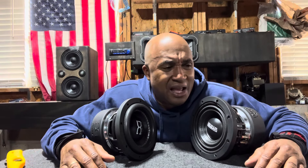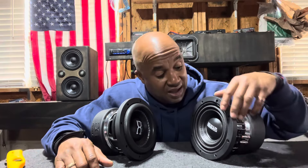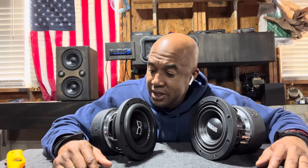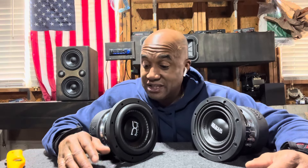But looking at the overall, the DC Audio is going to play louder overall where the U was just excelling in the lows. And I think that pretty much keeps up with the Sundown experience — people love the lows, but not all that balance, maybe because they put more emphasis on X-Max and cone area. Whereas DC Audio — you saw the movement — it has more throw, but it has to have more throw because it doesn't have the same cone area. As I showed you on the video with J-Audio, that's just fact: if you have more X-Max but not enough cone area, you're going to try to make it up in displacement. Whereas if you do have the cone area, you don't need as much X-Max. And they showed it — I played the same song: 114 versus 111.